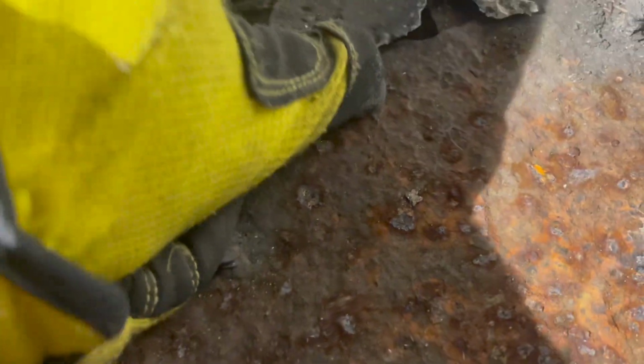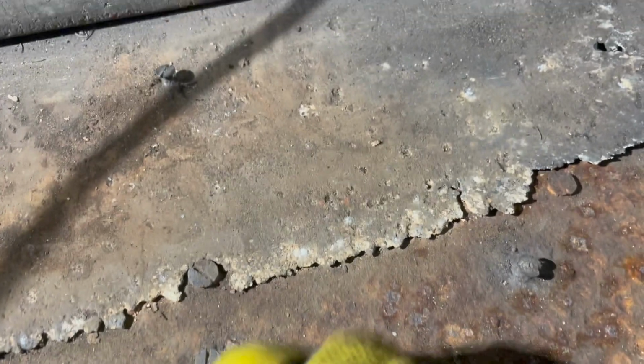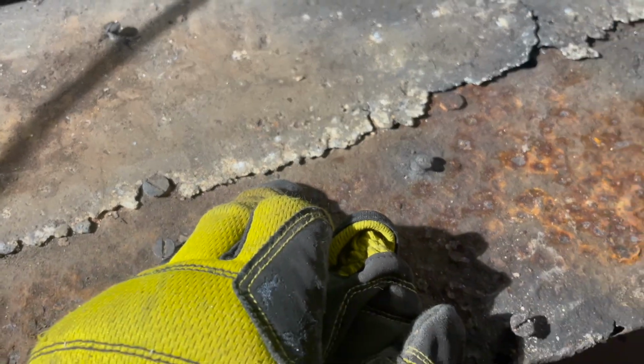And you can see this metal stops here, the steel does, and then this aluminum overlaps and loops under and is riveted into the rest of the bus. I'm not going to change any of this. This is just going to be fixed with a bunch of seam sealer, and that's still totally functional. This is expected after 70 years where steel meets aluminum. There's going to be some corrosion.